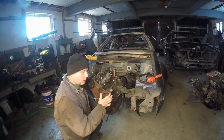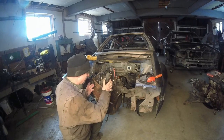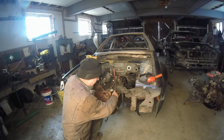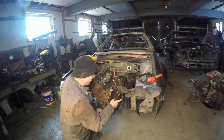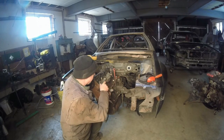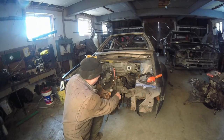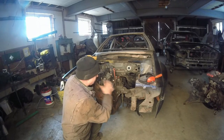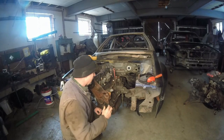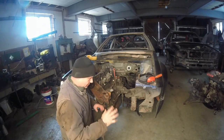The main thing was to get the drive shaft pretty much aligned, so the front subframe and the rear subframe are in alignment, so I can make the mounts. The mounts are going to be tacked in. We have CV joints at both ends of the drive shaft, so we have a little bit of play. We'll keep these as close to equal or in-line as possible.